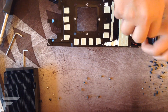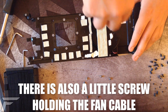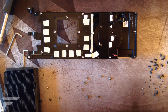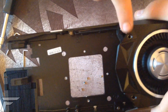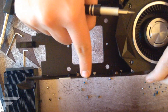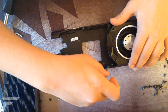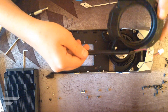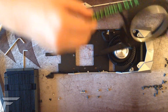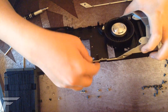You will have to remove these five screws on the back — two are behind the thermal pad — and then remove these four screws on the front. At this point the fan will come out. Then I'm going to remove this last part because there is a little hole near the fan where you can plug in the pump.